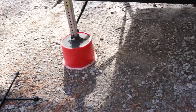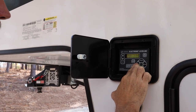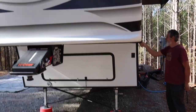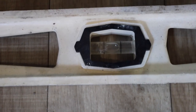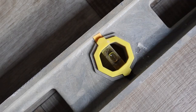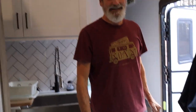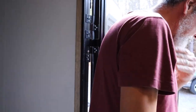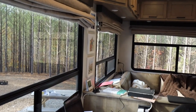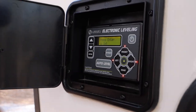This surface may look somewhat flat, but it's not. All right, let's check them now. Oh yeah, that one looks good. That one looks good. I think we got it — we got it! Now we want to tell the controller that this baby is level. Zero point calibration — press enter to set.